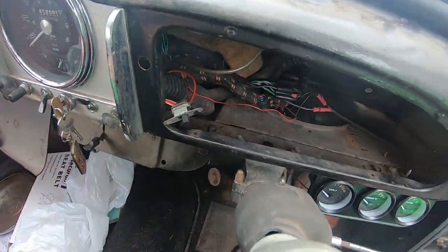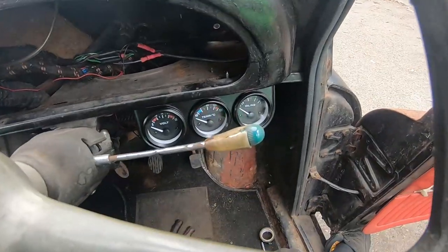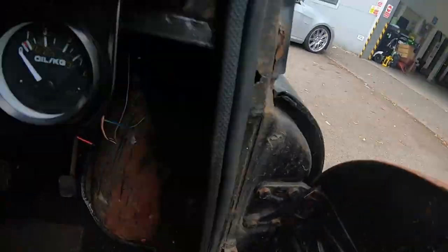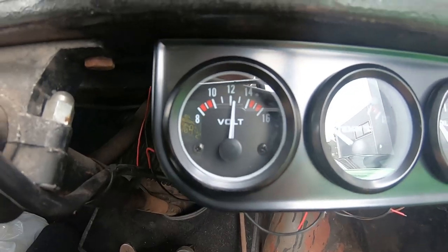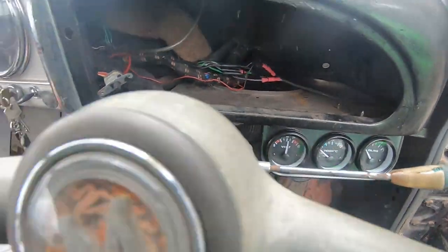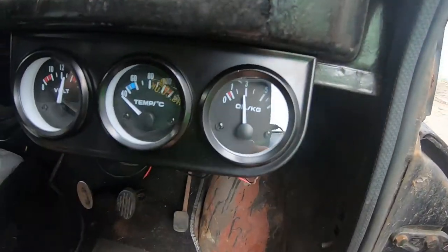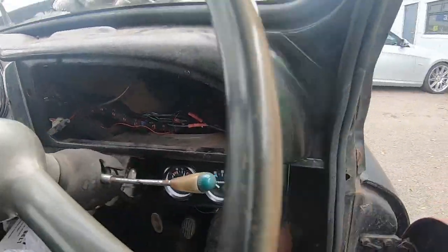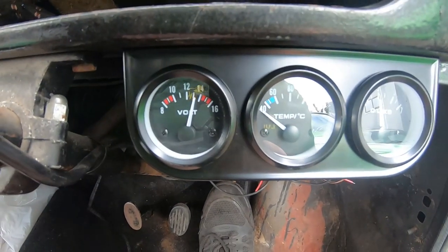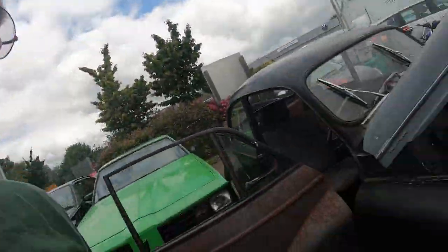That is all wired in. If I put the ignition on - none of those move. But if I put the light switch on - hey, it powers up! Look at that. I can see the voltmeter's reading just over 12 volts - it's about battery voltage. And if I start her up - I shouldn't need much choke. Starts well! Oil pressure jumped straight up to 3. Voltage is showing just about 13 and a bit. So while we wait for the temperature gauge to respond, let's just check for leaks.